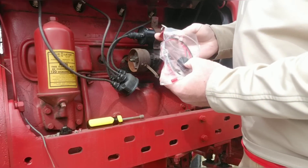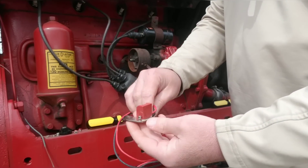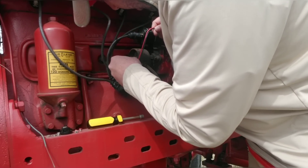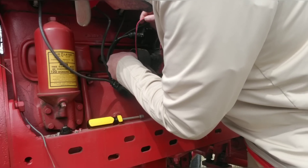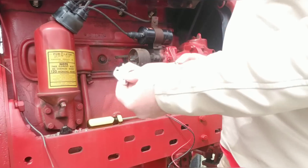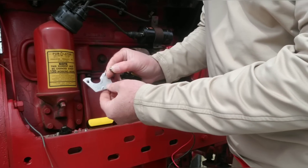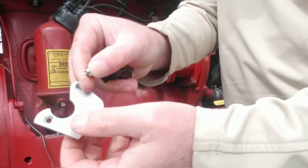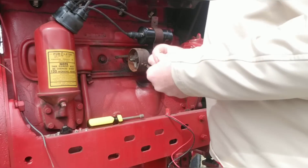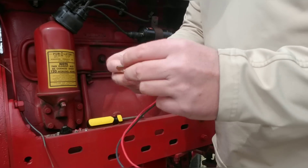This one's already mounted at the base. So here's your base — it's already mounted. I'm going to take that old base out of there and put this one in. I removed the mounting bracket out of the distributor itself. You can see there are two holes here — those are the same holes where the points go. Make sure you keep your screws because you're going to use them on the next mounting base, and this module is already attached to the base.